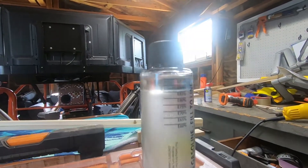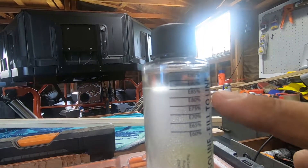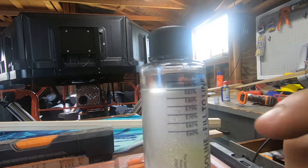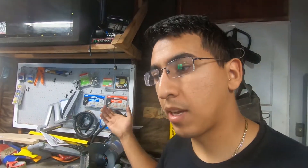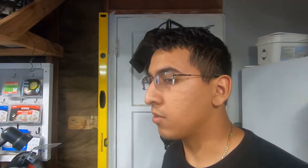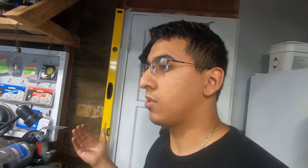So here we see, even though it's been sitting for like two or three months, it's still testing pretty good — still testing in at least the mid to high 80s. We can let it sit for a couple minutes to get an even more accurate reading. This is a quick and dirty way to do it, just so you can speed up the process, because I know you can't just be sitting at the gas pump forever. But if it was really bad, it would have dropped all the way already to like E70 or below E80. If it starts hitting below E80, then you just don't want to pump there if you're on an E85 dedicated tune. If you're on a flex fuel tune, then it'll be fine — later on you can find some better E85 and get closer to the E85 percentage.